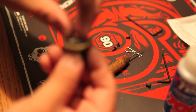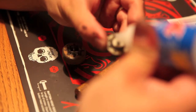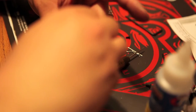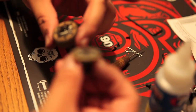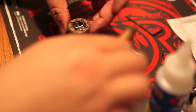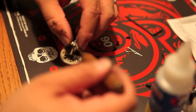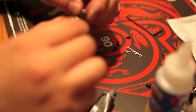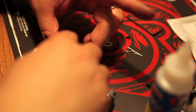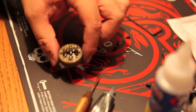Putting on the cross pin to the top half — if you've properly shimmed it, it should be kind of difficult to do. I'm applying some differential fluid to this top half before finishing the cap. It just requires a little patience to get it properly lined up, and once properly lined up it should work great. Some of the planet gears got out of alignment, so I'm going to go ahead and realign them.